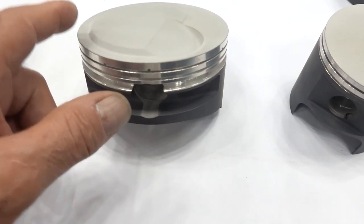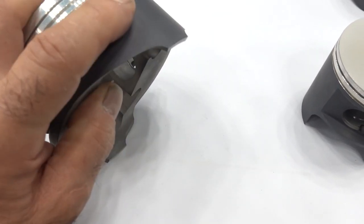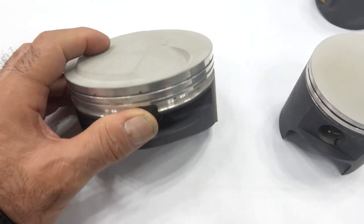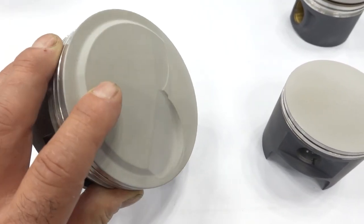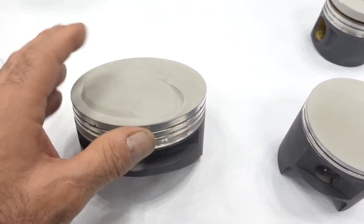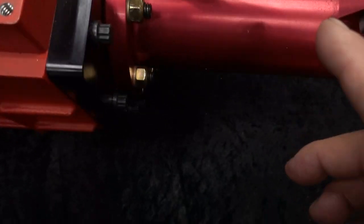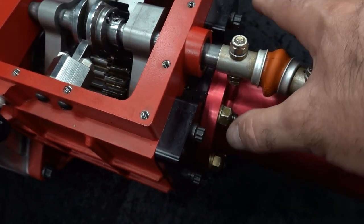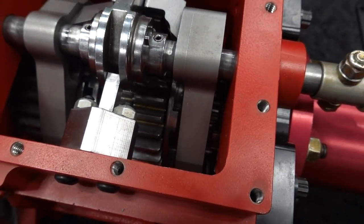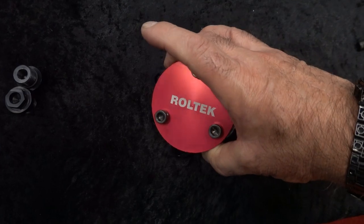So you've got the thermal barrier ceramic coating on the inside, and what is on the side over here — a lubricating coating, like a moly type of coating? Yeah, so you've got ceramic and then lubricating coating and it comes out beautiful. You do this yourself? Yes. So we've got a three-speed transmission — the whole gear set comes out just by taking these bolts off the back plate; the whole thing slides out once you take the forks off. Pretty slick design.